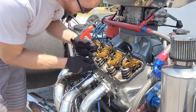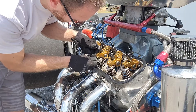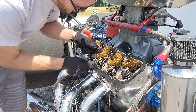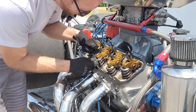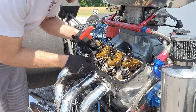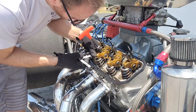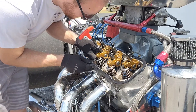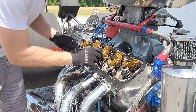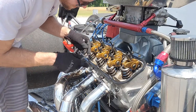If the lash is too tight, you're putting a lot of pressure on all of that valve train — the push rod, the lifter, and the cam. If it's too tight you could wipe out a roller and wipe your cam out — bad stuff. So you want to make sure it's the right number. If it's too loose, all of this starts slapping the top of the valve — you start beating up the tops of your valves and beating up the roller tips on your rocker arms.